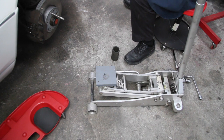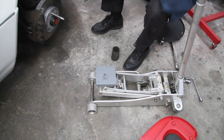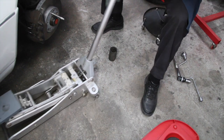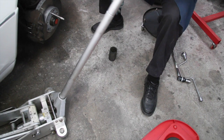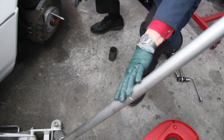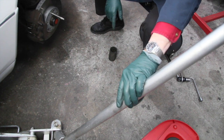There's one final comment I want to make. If you have the car up on jack stands and you're going to be working in this area, I recommend that you take the floor jack and move it right back underneath the position where you originally jacked, and just move it up a little bit until it's under the car. This is your redundancy — not only do you have a jack stand under the car, you've got the jack as your backup in case something happens to the jack stand.